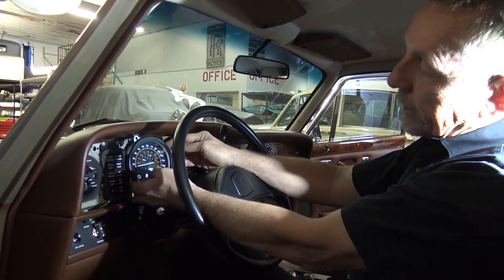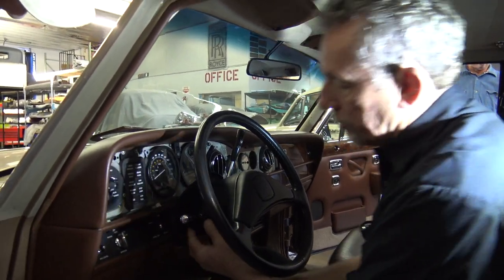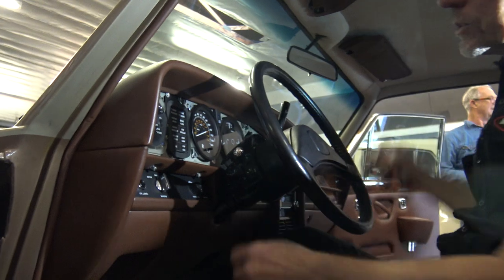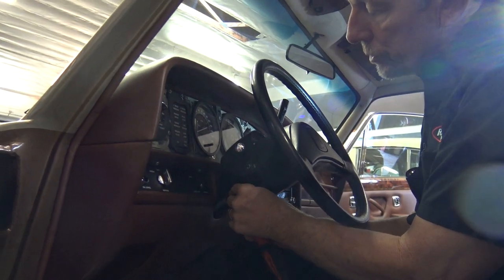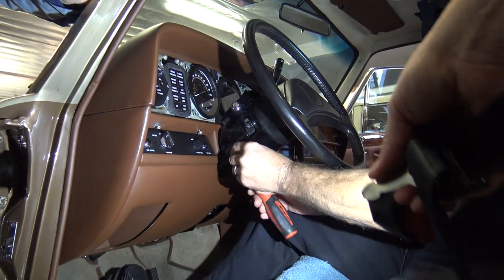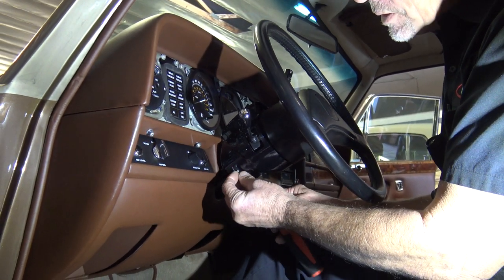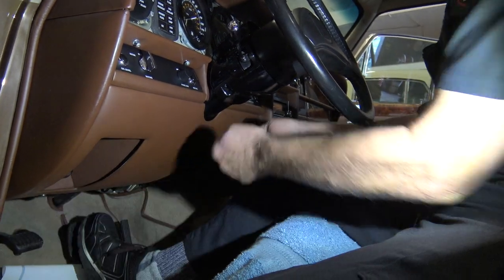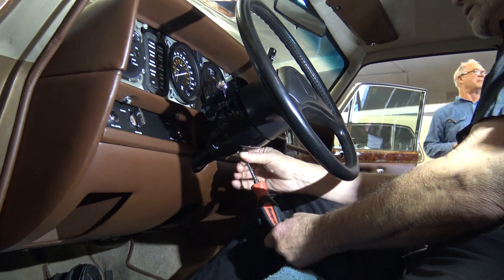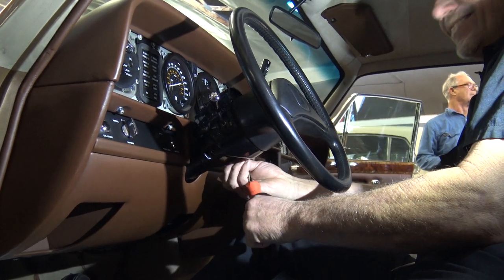So right now here's where we run into a problem — it's cockeyed and it's hitting this. Some cars you can sneak it out, some you can't. So I'm going to pull this upper steering column cover to get some more freedom here. There should be a couple of Phillips screws. Is the steering column adjustable? No. If it were adjustable, that'd be nice — you could just tilt it down. So this is going to have a little machine screw. Now, you can force it out, but you're going to scratch the plastic, and I'd rather not do that. Even though this is my car, I'm afraid to work on it because it's so nice.